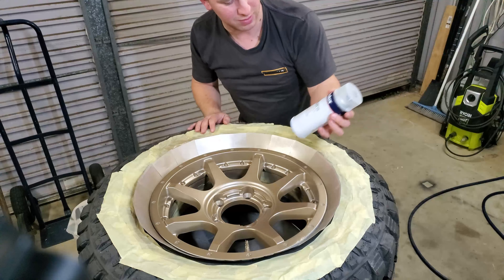So I'm using the Duralux semi-gloss clear coat. Good shake, then lots of nice small coats starting up high. It doesn't really matter if you overspray with clear coat because it won't be too obvious on the rubber. But essentially you don't want any runs in the clear coat. That's about five coats of clear, and it's looking really, really nice.